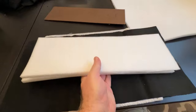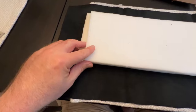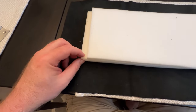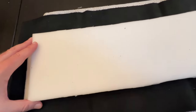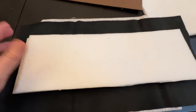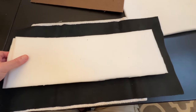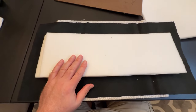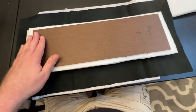Lay down your leather, then we're going to put our foam. The top overhang piece — make up your mind which way is front and which is back. This will be my front of the seat, so I've got a little extra half inch or so on that top piece of foam. Just center it — you want this as centered as possible on the leather. This is just so we have enough material to stretch and staple.